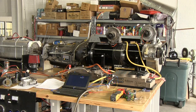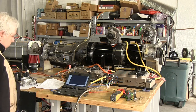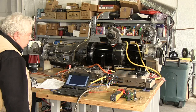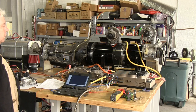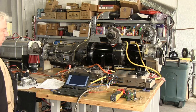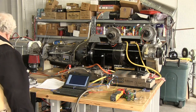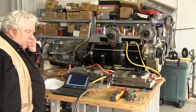If I bring up a little bit, here I'm at, coming up on a volt, and we're turning up. I'm at 275 RPM. I bring that on up to about 600, and then I'm going to turn it down. And guess what? We pick it up, and it's showing 425 RPM. I have it set at an idle RPM of 500, and we're idling fine. But the start button didn't work.